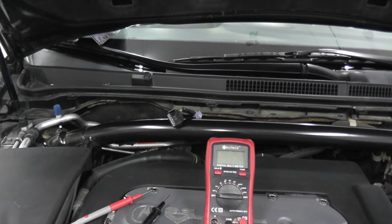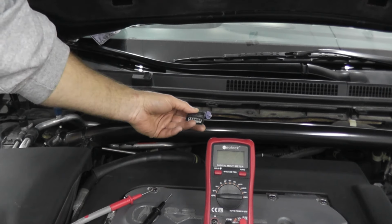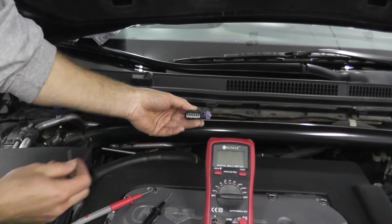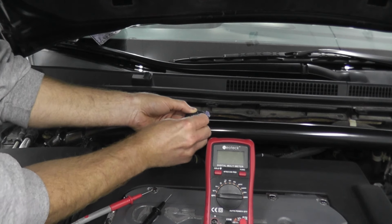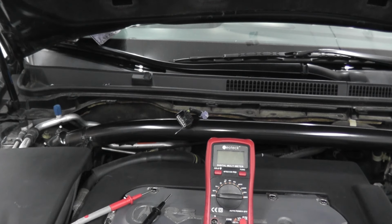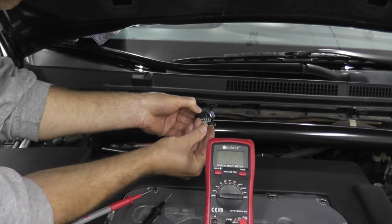Super simple. Now you could do a process of elimination. In my case, I did this off camera. In other words, I have 6 connection points. You have to find the 2 that generate the power. So in my case, it's the last 2 over here on the right. And this doesn't hurt the multimeter, just testing different leads. But I'm just touching these 2 leads with paper clips.